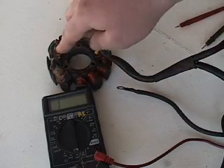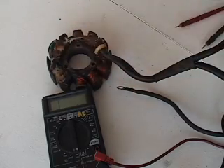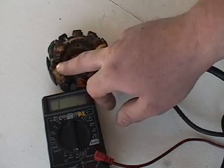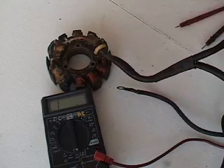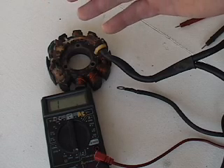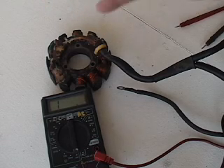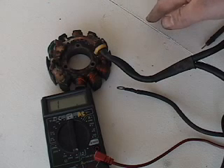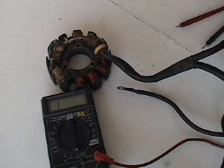With this one, you could have almost a 10-ohm change. But on this one, where it's a 25-spec, you can't go down to 15 — 15 is bad. This is usually just a couple ohms either way. Same thing for the ZRs and the 45-spec. You can't be over 45, but 43 or so — if it's really cold out it might be a little bit lower than that. But if you start seeing something in the 30s, it's very highly suspect.